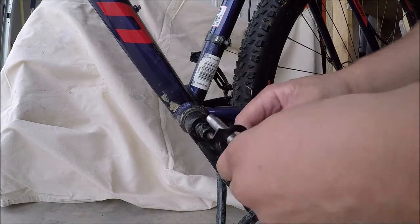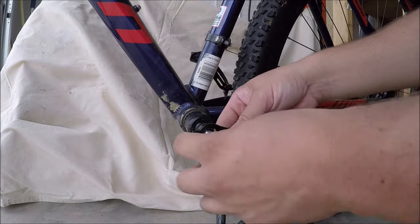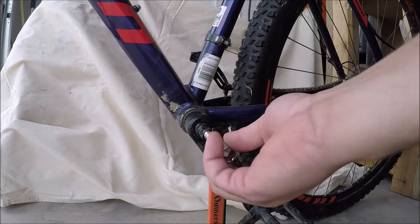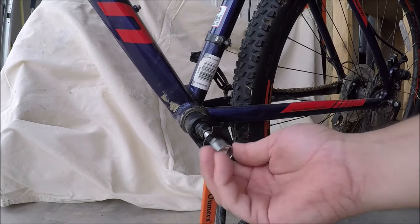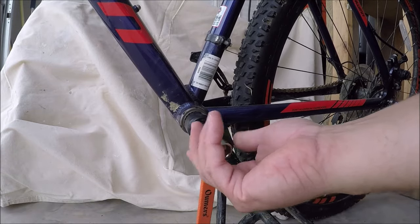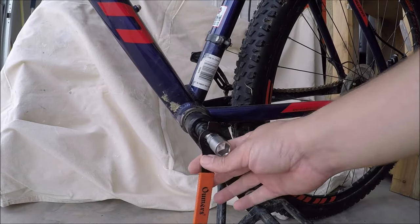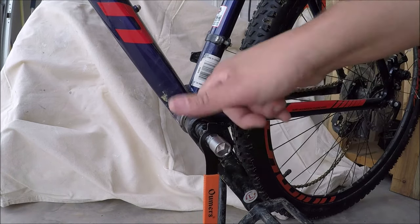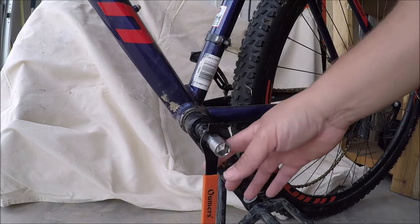Then you're going to go back to your silver socket. You want to put your wrench on — you could use just a regular crescent wrench in place of this as well, but I find this wrench works best. What you're doing is threading this silver portion into the black part in the crank arm, coming into contact with the crankshaft in the middle. So now you've got this inserted in there and you're going to push in on the crankshaft, which is going to pull the crank arm off.